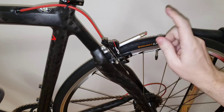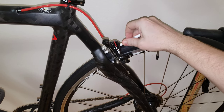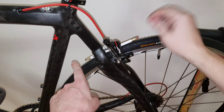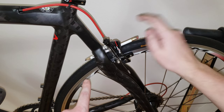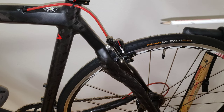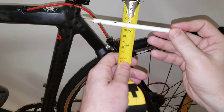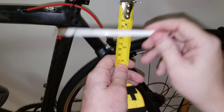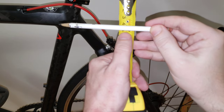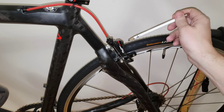To show that I'm not cheating, I'm going to rotate the pen around so you can see me wiggle it — and the pencil passes 100% through. I'm touching the top of the caliper and it's wedged in, touching the tire. I slide it out and this is the 8 millimeter pencil thickness. You can confirm that by checking the ruler: you have 5 millimeter here, and with the pencil over it, it's well over 5 — counting the lines it's 8 lines, which is 8 millimeters. So the gap from the caliper to the tire is 8 millimeters.